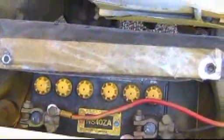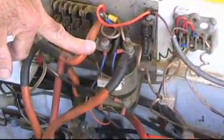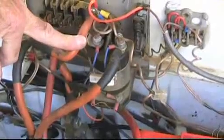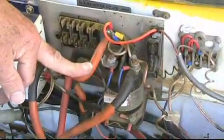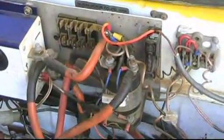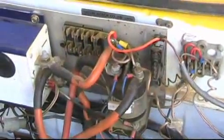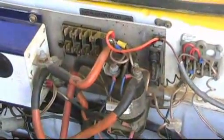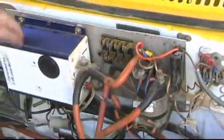The other component is a big solenoid, which switches the 48 volts on and off, and that is overridden by the 12-volt system in the fact that you have a little relay that switches that solenoid off. So if your 12-volt battery is flat, the car won't go — and the reason is that stops you driving the car without having brake lights or indicators or things like that.